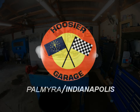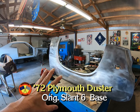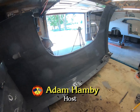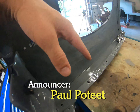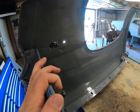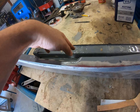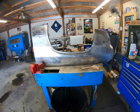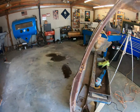You're watching the Hoosier Garage. We're back, and like we said on the last episode, we're just going to finish out some stuff on these fenders. This one is pretty much done — the one we spent that whole episode working on, splicing in areas. We have our POR-15 coated on the inside. We'll use the tie coat primer, then the proper primer that will bite into that, and then put our color or undercoating. Just needs to be light sanded and it'll be ready for epoxy.